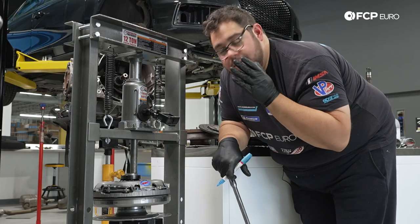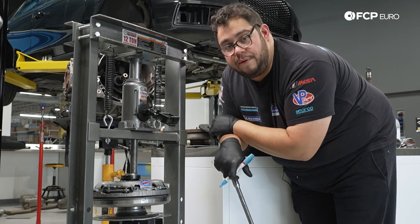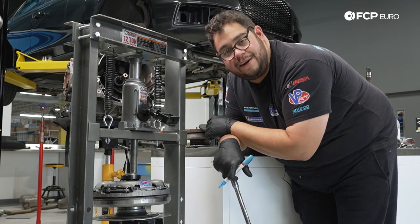One last thing while we have the camera in focus: should you be reusing your pressure plate and want to readjust it, now would be the time with everything pressed down. Again, these two tabs you would clock back in so the spring compresses, and you can reuse that pressure plate. Now let's hop over to the transmission — we're going to clean up the inside of our bell housing, replace the throwout bearing, all that good stuff, and go from there.